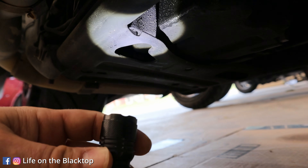Put your pan under there, then you loosen your bolt. Then you'll come up to the top here — this is your fill port. You'll take that out and then it'll drain a little quicker. Once that starts draining, you can loosen your fill plug up here, which is a three-eighths hex. That's your dipstick for your transmission, and then it'll drain a little quicker down here. You can always tell when you're leaking transmission fluid on this.